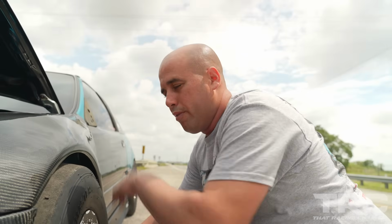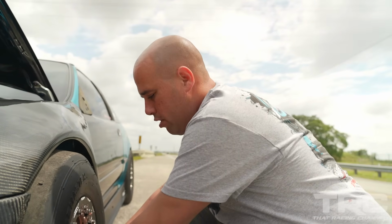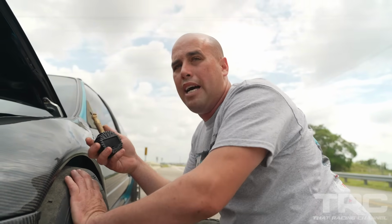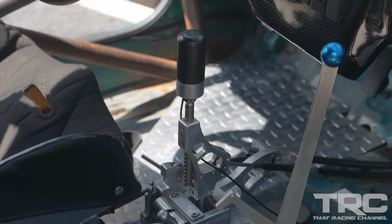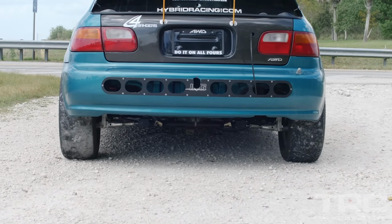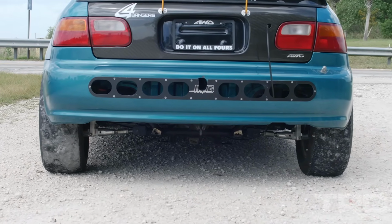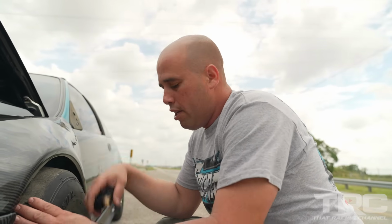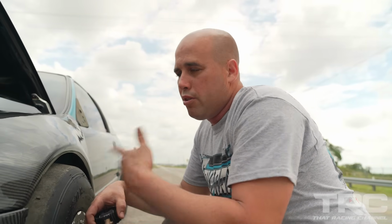This is one of the first cars that I made all-wheel drive. Probably top five, this is one of them. And then transmission, you got the PPG dog box? We run right now a billet housing with the PPG 1 through 4, and Drag Cartel billet transfer case, PPG transfer gear, and all the good stuff. And the PPG spider gear as well. That was one of the main problems with this K-Series all-wheel drive. The spider gear always gives up. So right now PPG makes a nice spider gear, so we'll be testing.